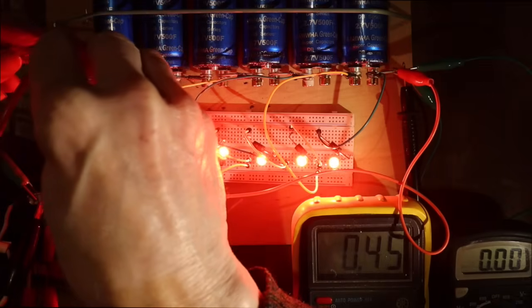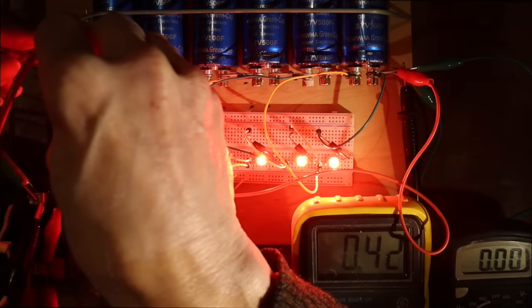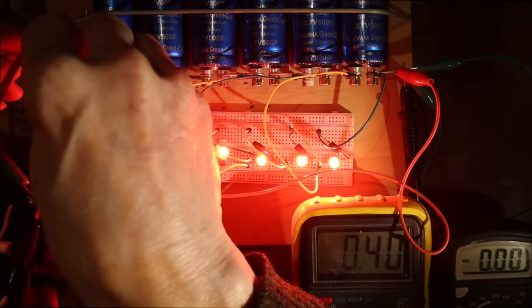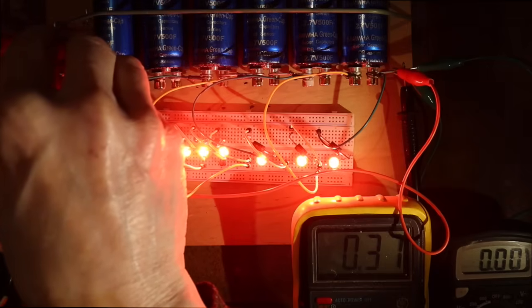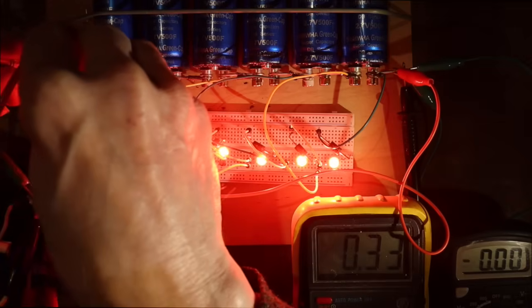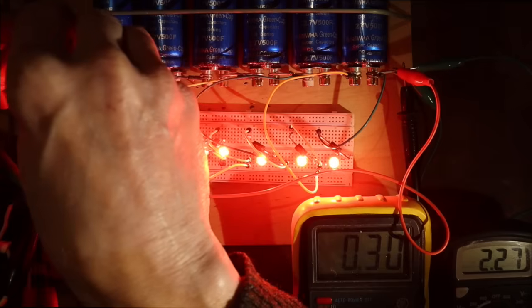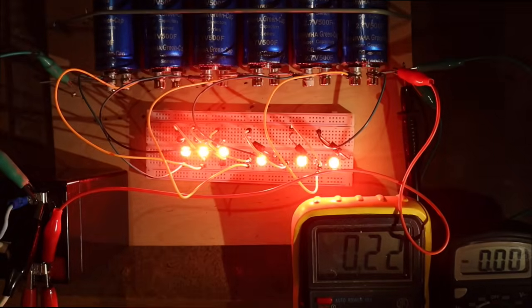Now the total voltage is of course 14 volt, because I read it on the power supply. The current is still 1.24 for the power supply, of which 0.4 is going to the capacitors and the rest goes to the batteries. So we have here a voltage of 2.27, 2.26, 2.27, 2.26, 2.27, 2.26. Well, that seems perfect.